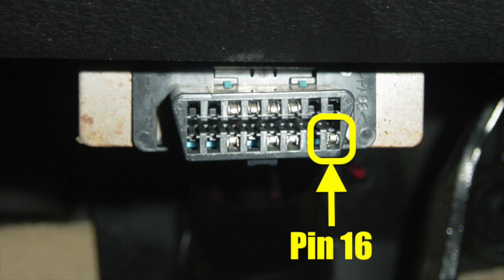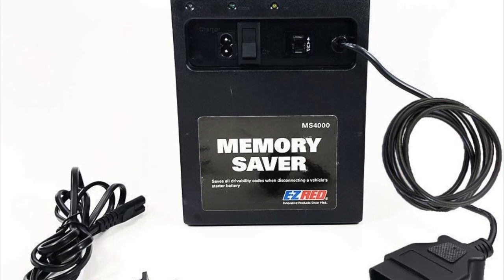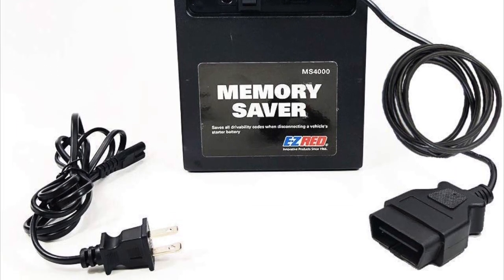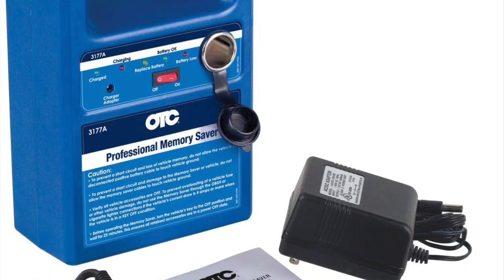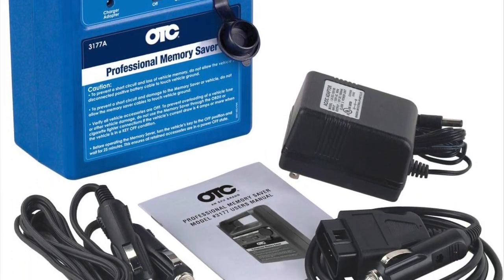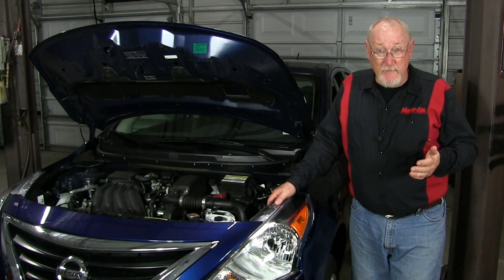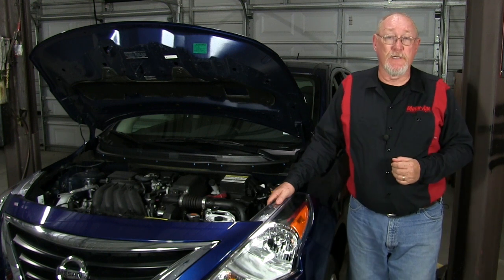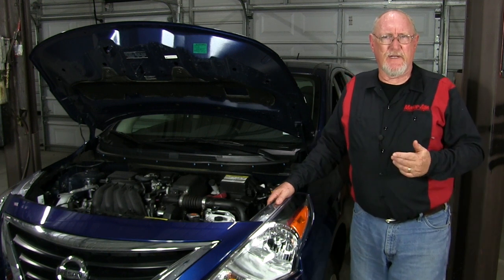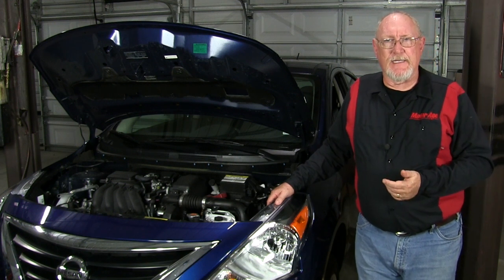It's like jumping to the battery terminals themselves. Memory savers are available from a number of sources. Look for a memory saver designed to work with your existing 12-volt jump box or that has its own dedicated 12-volt power supply. Stay away from any memory savers advertised that rely on a 9-volt battery as the power source, or are designed to be plugged into a cigarette lighter or power outlet.